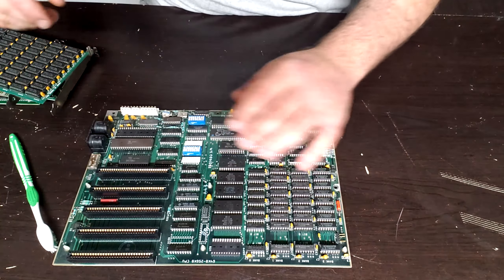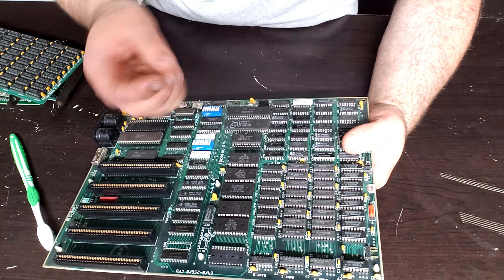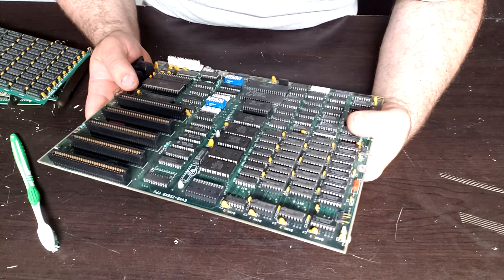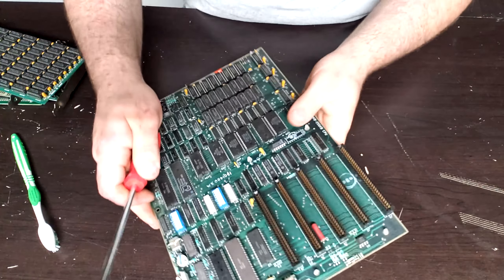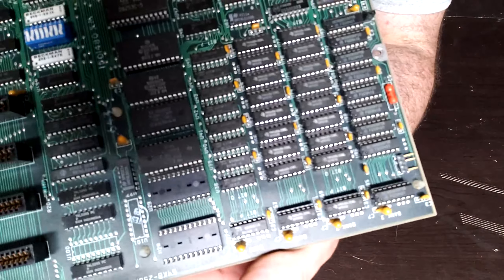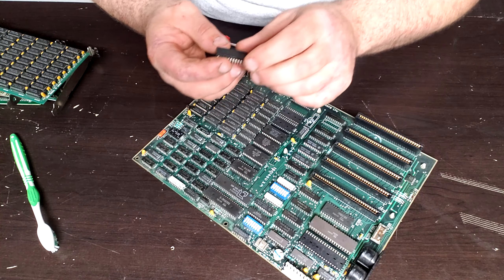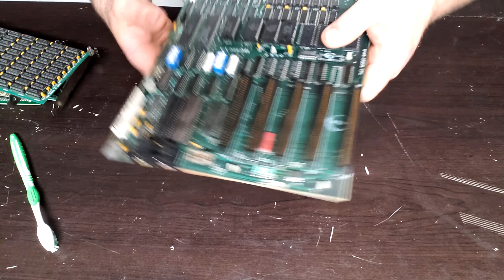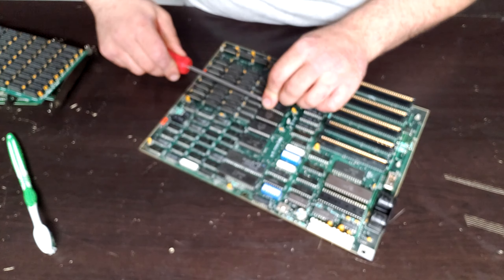Now we have the mainboard with all the cards cleaned. Looking at some chips here — I know these are the BIOS chips — but I do see some corrosion underneath. I'm going to pull off all those chips real quick. Maybe that battery was actually leaking more than he thought. I don't have a proper chip puller — U29 is not too bad, I need to make sure I keep these in order. There's U30, I do see some tarnishing on the legs but not too bad. There is corrosion though, and I think I see a broken pin.